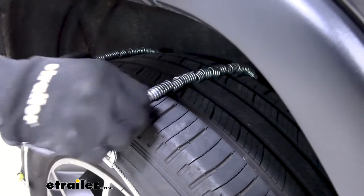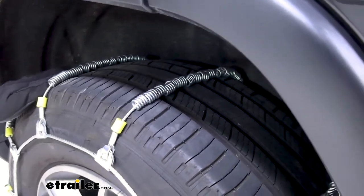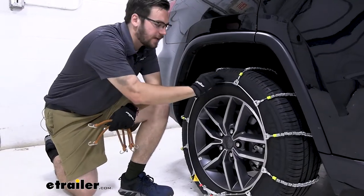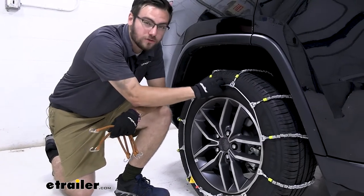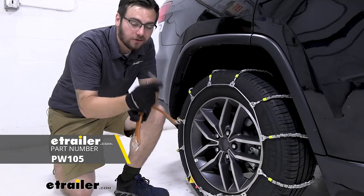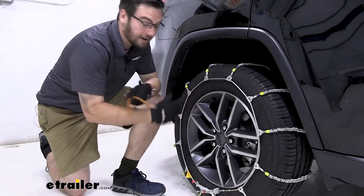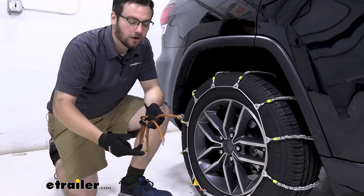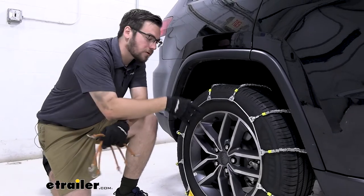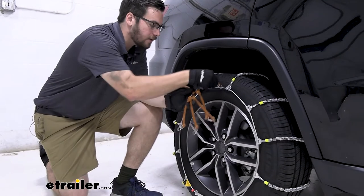This coil here is very tight against our tire, which is great because we want to make sure we have a nice and secure fit. One last little thing for installation — as this rotates, it is going to be starting to shift and get a little loose around your tire. It can be very nice and almost integral to go ahead and grab yourself a rubber tensioner as well. This is going to make sure that we're pulling and staying even across our tire, even as we are in long transit. This is especially great if you find yourself taking longer drives where you really need your chains on for a lengthy amount of time.